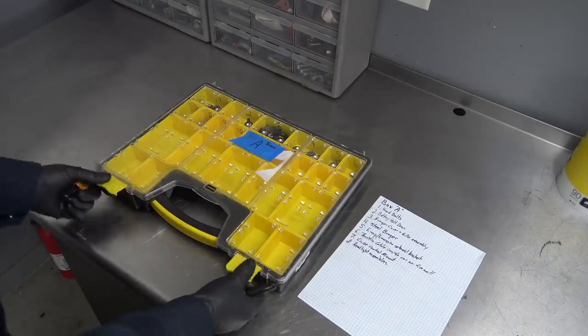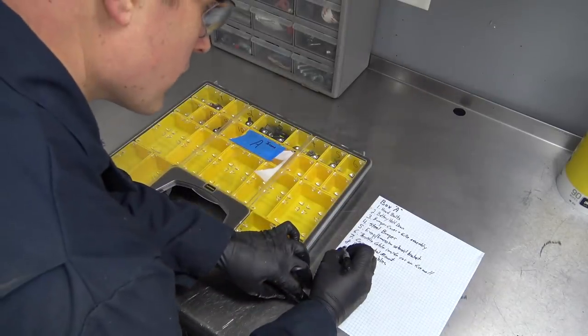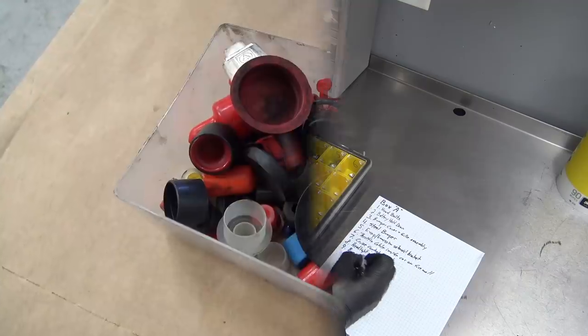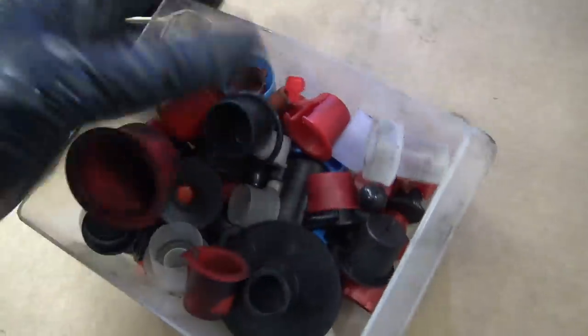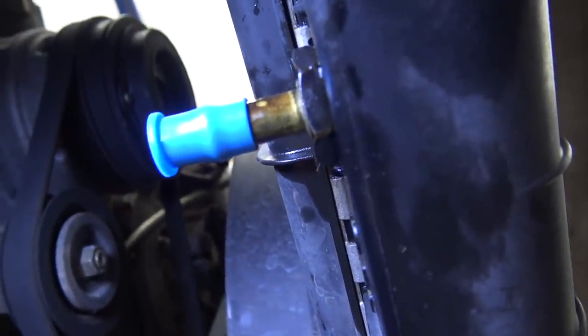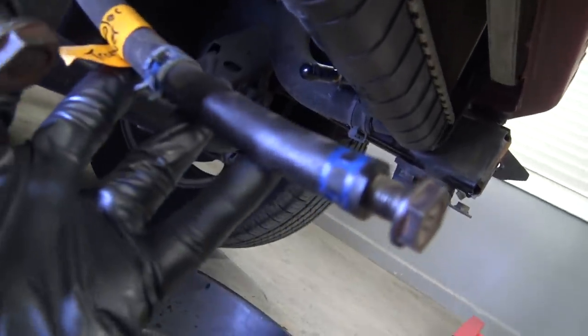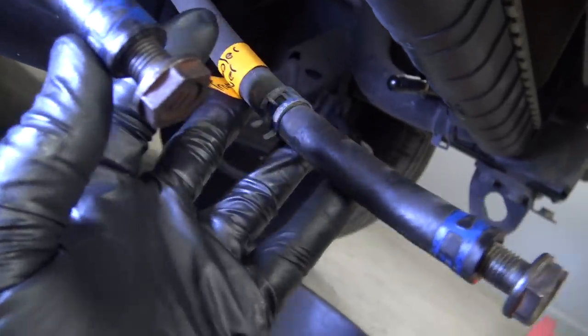As I've been removing pieces and parts, I either keep the hardware with the part or put it in one of these hardware organizers — I like this kind with the removable bins that are different sizes. Some may call me a pack rat for keeping all sorts of little caps and lids over the years, but they really come in handy in situations like this when you want to plug these drippy transmission cooler lines that come out of the radiator. And to plug the lines from the transmission, I use some old Mitsubishi flywheel bolts — yet another argument for just keeping everything.